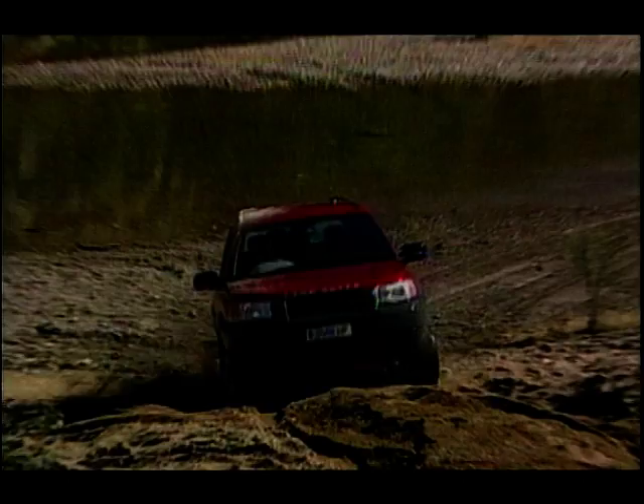Having built our first prototypes and tried them, it was clearly a good system, but we felt we could add some extra dimensions and impart knowledge gained in off-road driving within Land Rover into the software controlling the unit. For example, if you're going down a slope and nine kilometres an hour is fine, but if you come across some broken ground, it's probably appropriate to go a little bit slower. We have the ability to pick up sensing of broken ground through the wheel speed sensors into the control unit. It recognises rough ground because of the change in wheel acceleration, and then checks the ABS modulator to slow the vehicle down to about seven kilometres an hour, giving that little bit of extra control.